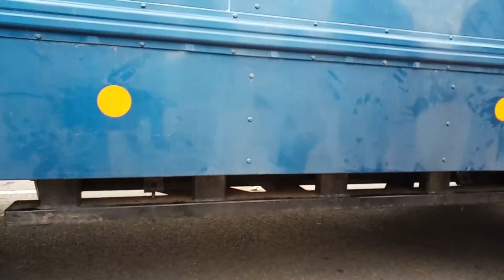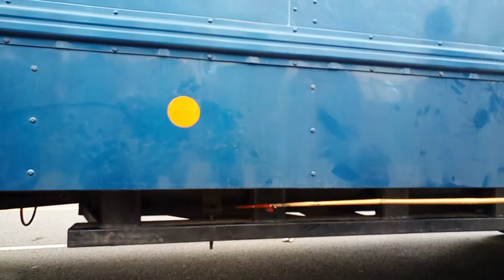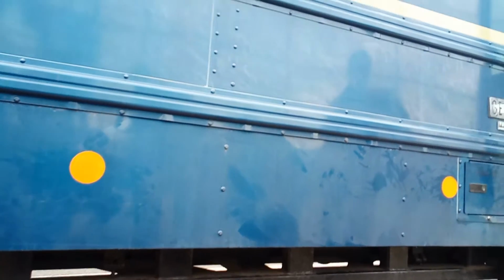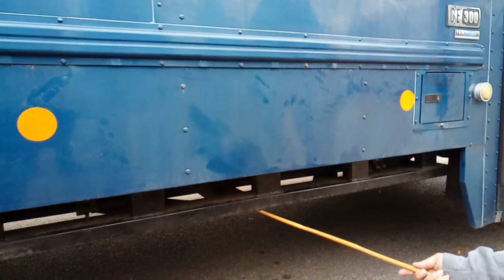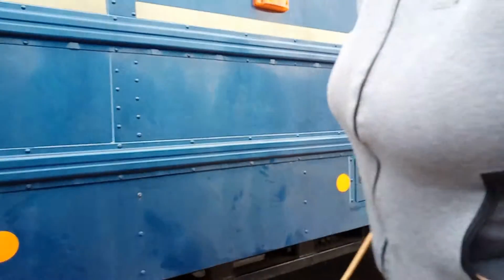Okay. Then, this is the part. Gotta get down. That's fine. Okay. My fuel frame is securely mounted to the bus, not dented, not cracked, no welding damage. The fuel tank. First thing, you're going to look under here and say no leaks. There's nothing leaking. Then you're going to say your frame. Your fuel tank is securely mounted by this frame to protect it from any accident. Yes. No leaks. Right. Have to mention that. Yes, you have to mention that. Okay. Thank you.